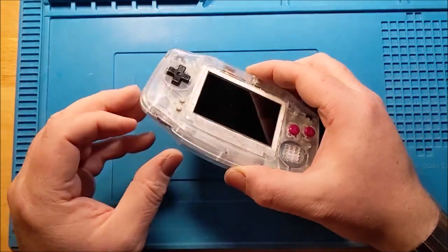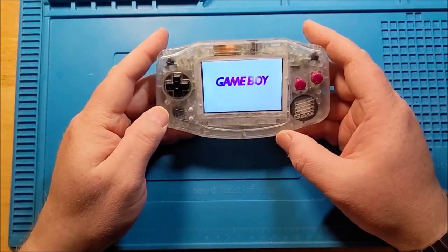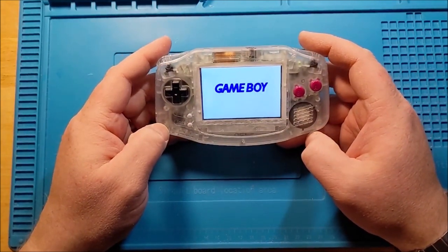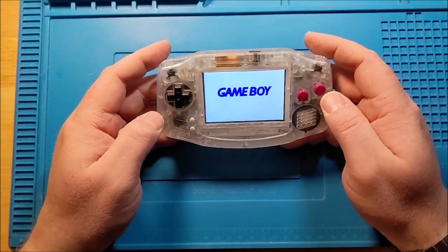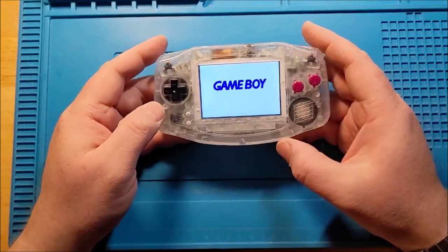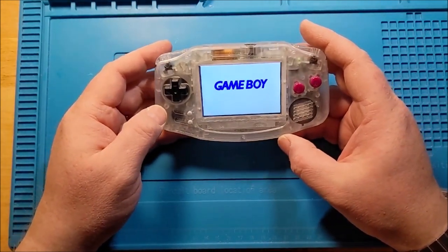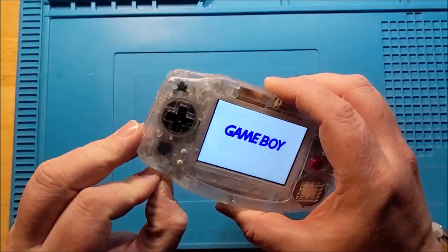Before we put the screen or the lens on, we double check to make sure that it's centered. And it is. That looks good. And it is definitely brighter. Yeah, I didn't do an awesome job on the solder the first time, so this is looking awesome. And that's pretty much the same dimensions as the original screen, but with a great backlight. So, yeah, I'm really happy already.